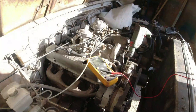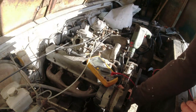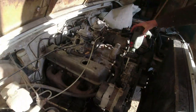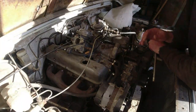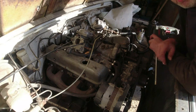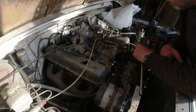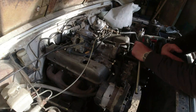But all I'm doing here is driving the top of the oil pump. Oh, bloody wires fall out down here, that's why. But I'm driving the top of the oil pump. You can do it in a number of different ways, because I do it quite a lot. I bought the little adapter that you put onto these later style things. Basically, after I do an oil change, because the distributor was out anyway, I thought, right, just wind the oil pump over. It goes at a fairly high speed. You can't do it with a battery drill, it's got to be a mains drill. Wind it over at fairly high speed, and eventually the drill goes under quite a lot of load. That's the point where you've got the system primed, and then just double checking by checking that the oil pressure light goes out, or you get continuity or lack of continuity to your oil pressure sensor.